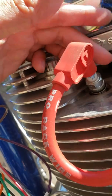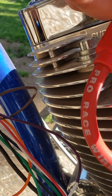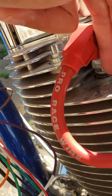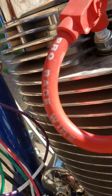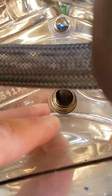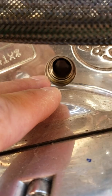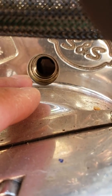When you take this plug out, drop a screwdriver in there and it shouldn't go far — it'll probably go only one-fourth of the way. If it goes the full length down, that means your piston is at the bottom, so you need to bring your front piston up. Some engines report TDC for top dead center; this engine reports TF, which also stands for top dead center.